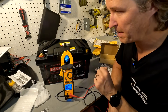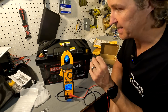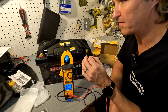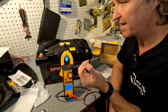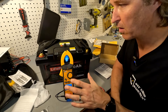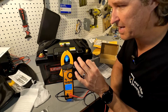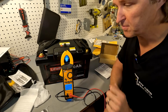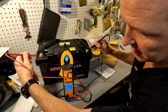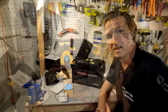When you first receive your battery you should check the voltage and do a capacity test to make sure you're getting what you paid for. The voltage is important - you don't want them storing batteries at a really high state of charge like 13.8 or 13.9, and you don't want a very low charge like 11 or 12. You want it right around 13.1 to 13.2 when you first receive it. The voltage reads 13.16, which is exactly where you want it.